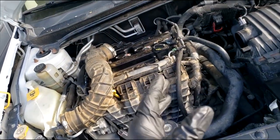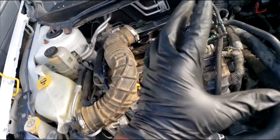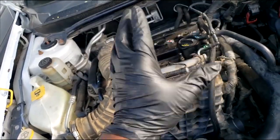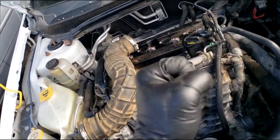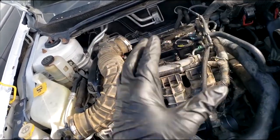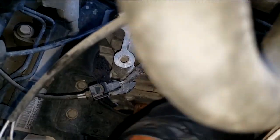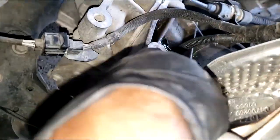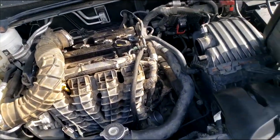Now I could spend time going through the full circuit, or I can grab one of my spare crank sensors, plug it in, and see if the car starts. That's a whole lot quicker — I can write up an estimate faster and finish the diagnosis. And the number one thing is I'll be able to drive it in. I want to apologize for not scanning first, but explaining where I'm at is worth more than the apology itself. The crank sensor lives back here behind this shield — I need to grab a couple of tools to gain access to it.